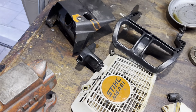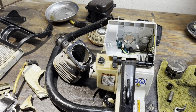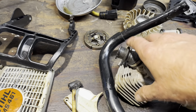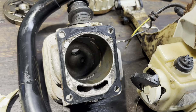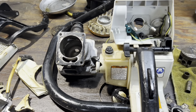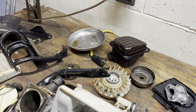Let's have a little fun with this one. I still got some unanswered questions. This saw sat before it came to me. There was an obvious issue — I pulled the muffler and the piston was scored up. And because it sat, you can kind of see some traces of rust in there.